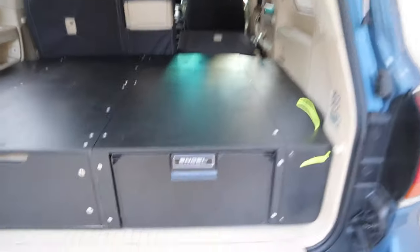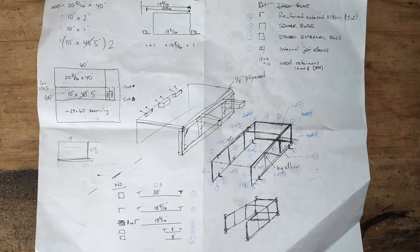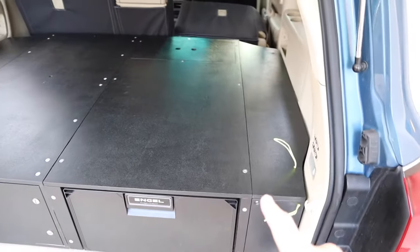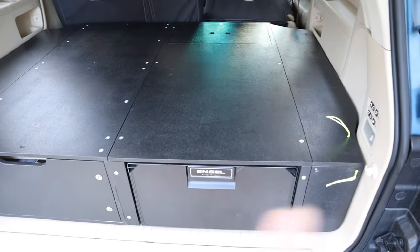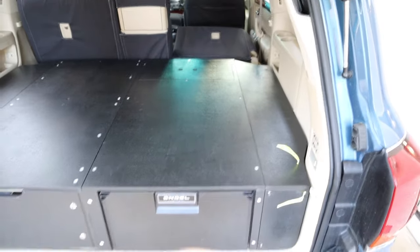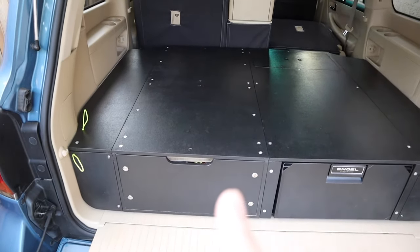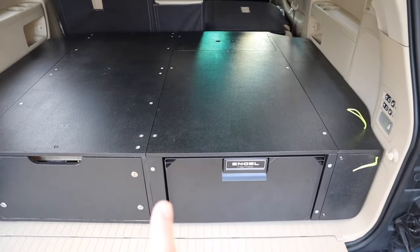The reason for that is I needed a way to mount this in, and it's off-center here. I didn't really figure it all out ahead of time. I was planning on a mount back behind here and it ended up being about six inches back, and then there's another mount right here underneath the wing — you can kind of see it down in there. There are two more mounts in the back area by the battery. The whole unit — the wing, everything — you could treat it as all one piece. You undo those four bolts and you can slide or lift this whole thing out. The same is true on this side; there are six bolts holding it all down, and the idea is to loosen those bolts and pull it all out.